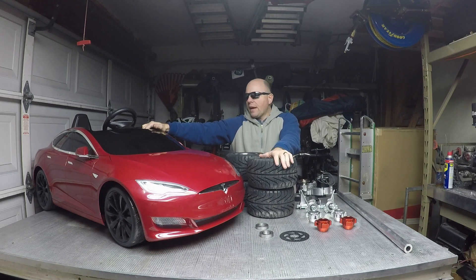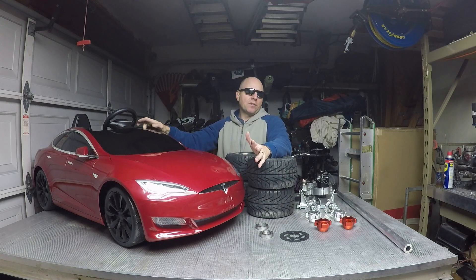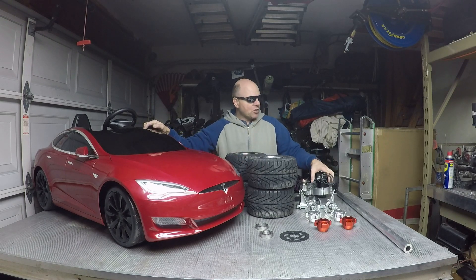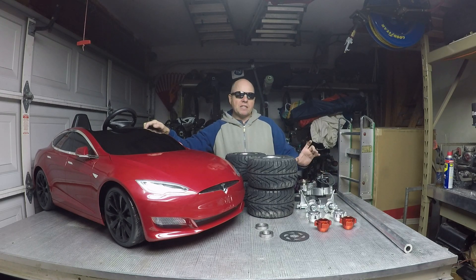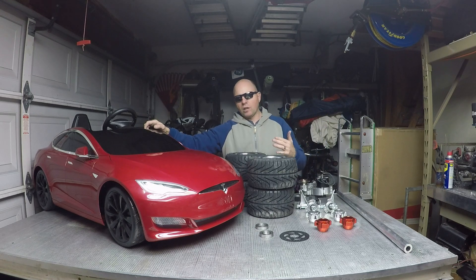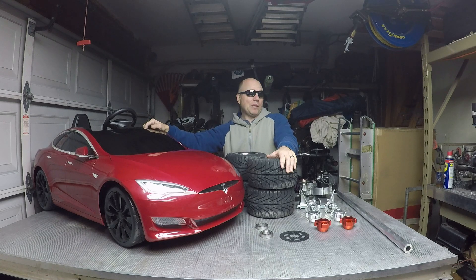I think it's too small to gear it any taller than that. I really want acceleration — I don't want something that's going to flip over on corners. The amount of power and torque this thing will have will be mind-bending. These AstroFlight motors, though they look small — a little over three inches in diameter and three and a half inches long — the torque they put out is monumental, and the RPM is very high so they can be geared very low. My biggest concern is flipping over backward, so I will put a short wheelie bar off the back with skateboard wheels on it, because it will lift the front end. The biggest difficulty will be programming the controller to keep the front end down.